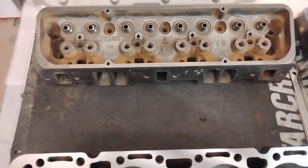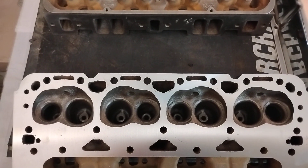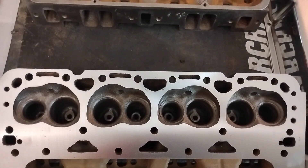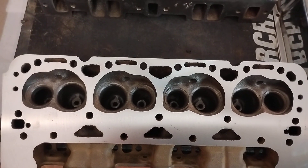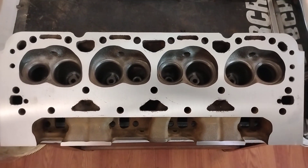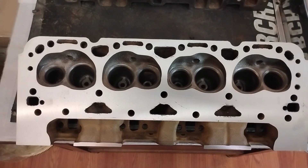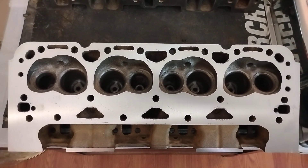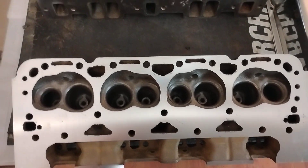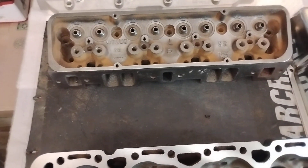That cam I've selected out of the build is to make a lot of low-end, good cylinder pressure. It's a 10-to-1 compression, so it might need better than the cheap shit fuel. But it'll just be cruised around, and it probably won't have more than 30 to 32 degrees timing in it, so I think it'll be alright. Not every engine's gotta be a 9,000 RPM fucking racing engine.